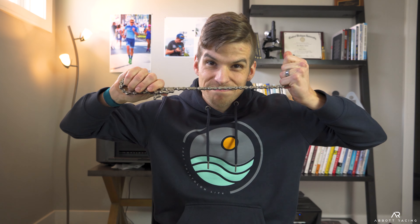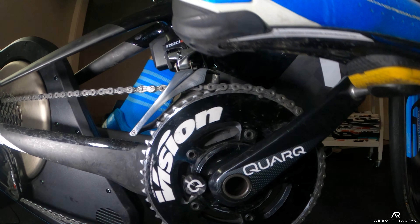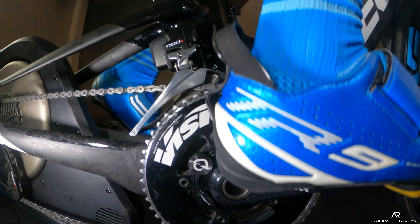All of these pieces are trying to slide along each other. I've got my roller bearing trying to slide along here, which is trying to pivot around this piece, which is being stuck to that piece. So there's a lot of opportunity for pieces to get stuck to other pieces as I'm pedaling along. And that's not to say anything of the tension I put into my chain — the harder I pedal, the more I pull on this, driving all the pieces into each other, just generating even more friction. Believe it or not, that is not the main thing you need to be worried about.